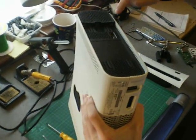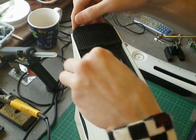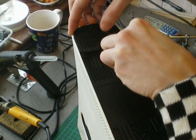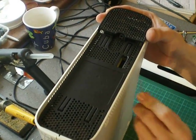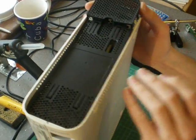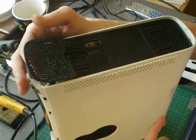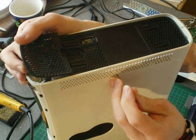There's two holes there and there — they're highlighted in the picture guide. Get your small screwdriver, poke it down the hole and you hear a snap, then another one and it pops up. On either side there's another two holes — poke your screwdriver in where you can see the little tab and it will pop up. Same for the back one, pop up, turn it around. You want to keep a little bit of upward pressure to stop them locking back in whilst you're doing this.